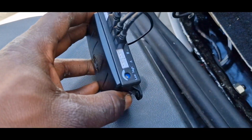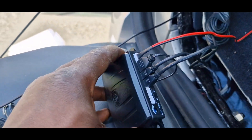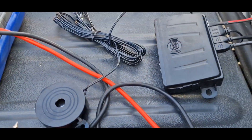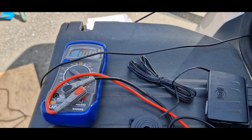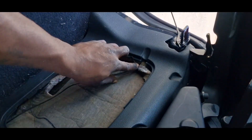These parking sensors are only wired up as a two-sensor system, so we've got C and D plugged in. When it starts up you'll get two beeps, which normally indicates a fault with two sensors — but there isn't one, it's just the way it's going to work with this configuration. Here's the reversing wire.